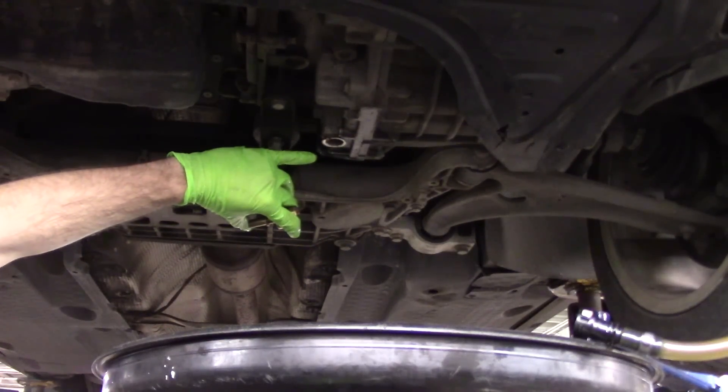Because if it's barely trickling out and the actual temperature rises, the fluid's going to come over the top of that fill tube and come out — and it's not even trickling now, barely. This tranny is borderline at the level, it may be a hair low. Alright guys, so this tranny is a hair low — what I'm going to have to do is let it cool down, add another quart, and redo this procedure. I'm not going to video that. I just want to finish this one up, do the basic settings, code the new TCM, and call it a day.